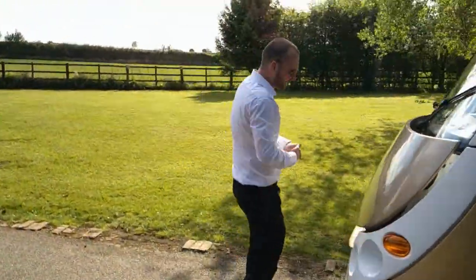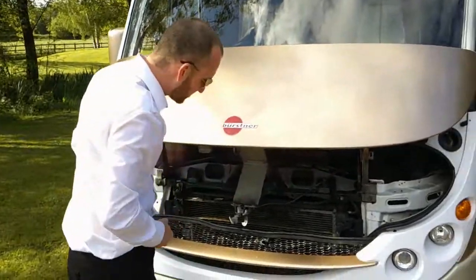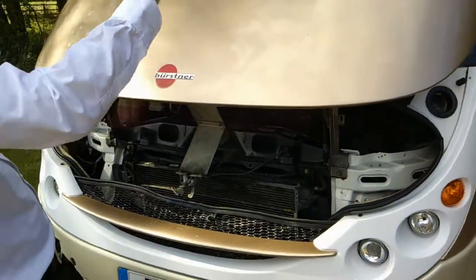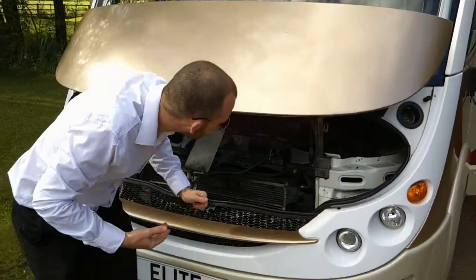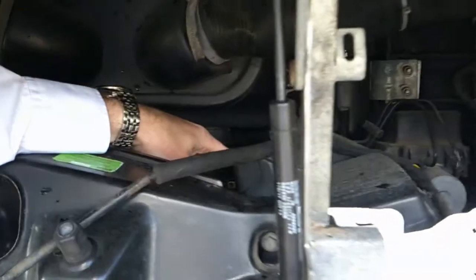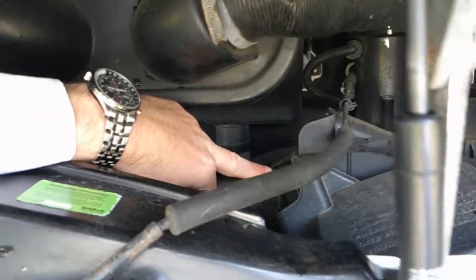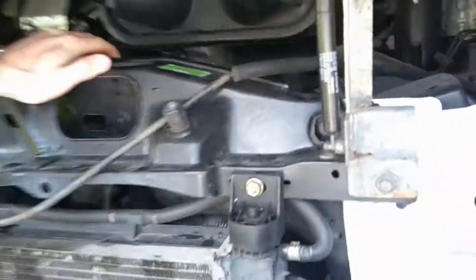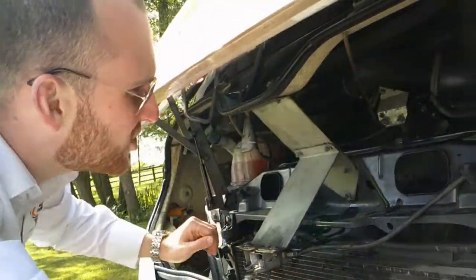The bonnet has a cantilever action on these A-class motorhomes. Just above the fuse box, to the left of the fuse box cover, there is a little flap which you lift up, and that exposes your positive terminal — that's where your red crocodile clip clips on. Your negative is only an earth point, so you just need to find a chunky bit of metal. Just to the right of the engine block there is an engine mount, which is a really good solid earth that doesn't rust, where you can put the negative onto.